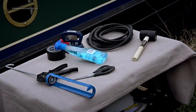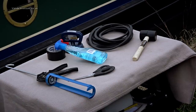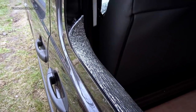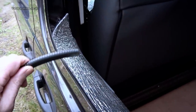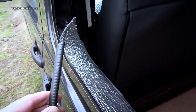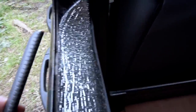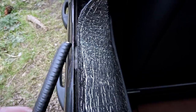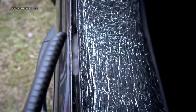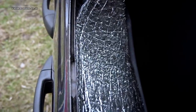I feel a bit like a surgeon preparing his table for an operation. Currently waiting for the hammerite to dry and pondering banging on the trim, but there's a slight hiccup — despite ordering the trim that was supposedly for this van, the gap between the inner and outer skin is substantially wider than that trim will go over. You can get wider versions of this trim, but this is the stuff that was supplied for this van and it's clearly not wide enough.